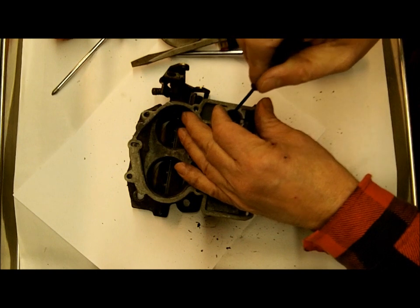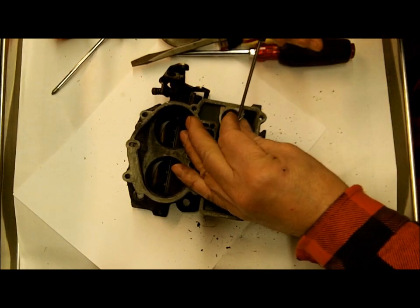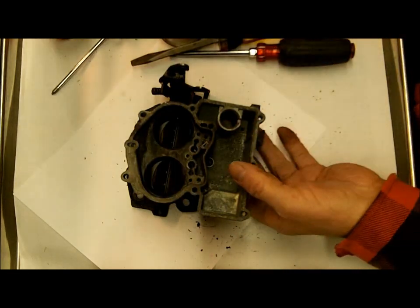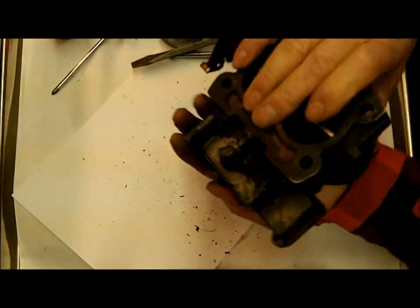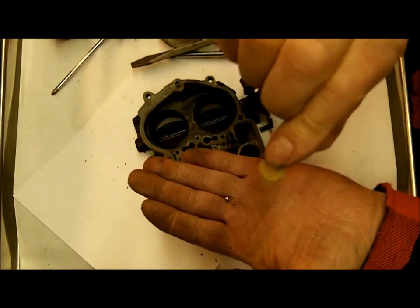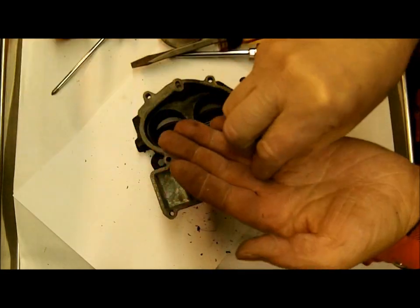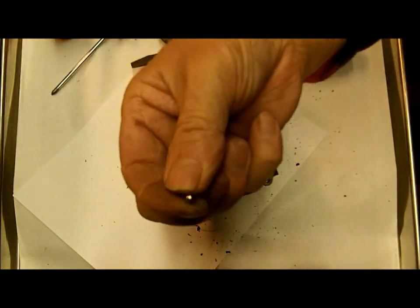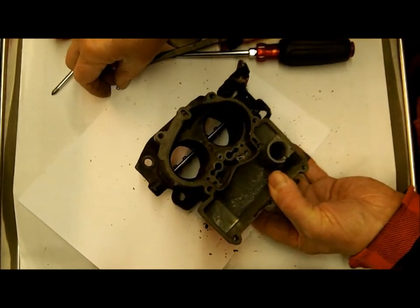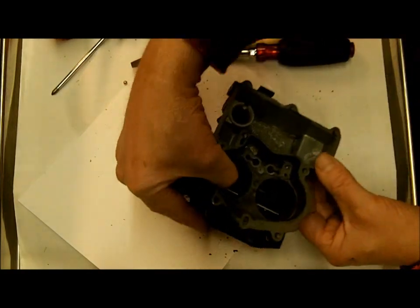I got the jets out. You've got this little retainer here that goes in the bottom of the accelerator pump reservoir. Be careful you don't lose this stuff — it's not in the kit and it's just impossible to get. You've got the little screen here, which I'm pretty sure comes in the kit — that's just to keep the dirt out. And you've got your check ball that goes in the bottom of the accelerator pump. Take note of what size it is — it's a fairly big one. People get these mixed up.